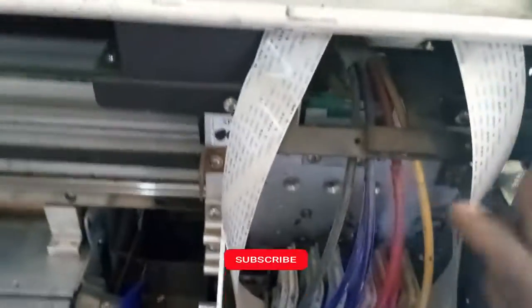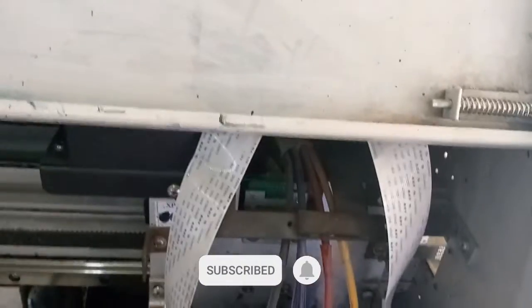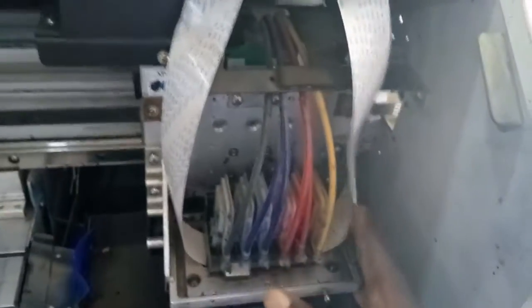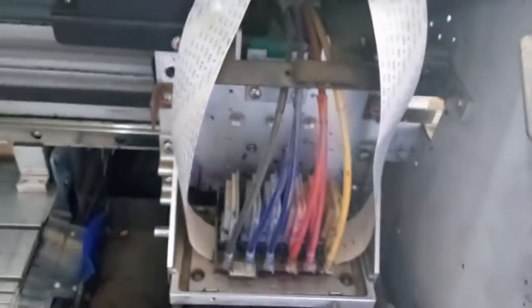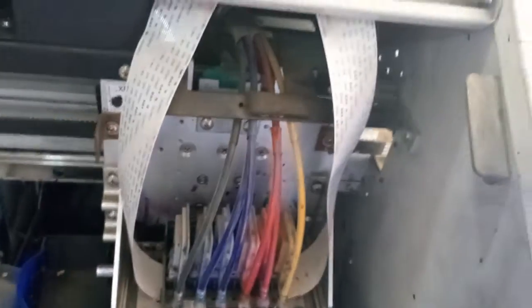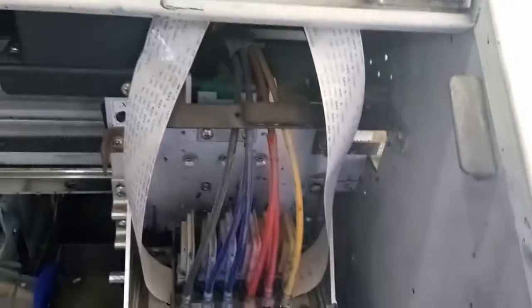If you have error link fail, check that the cable is properly connected — especially check those two cables. Confirm the cables are good. If you've tested the printer head cables and confirmed they're properly connected, and tested the carriage board and driver board connections, and the cables are new, and you still get the error, then the problem is coming from one of those boards.